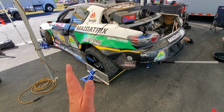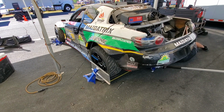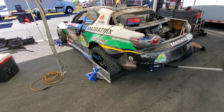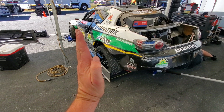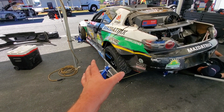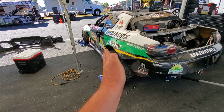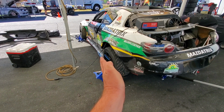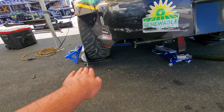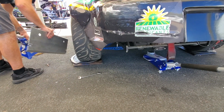Now, in regards to your camber, same thing. Factory suspension, different iterations of Mazda 5-link suspensions can move different ways under loading, but with the Wisefab, we're also looking for not any type of significant camber changes. Although in the RX8s, in most Mazdas, in most cars, as you go from droop to compression, you're generally gonna go from a camber out at droop to a camber in at compression. And it's really important that under your acceleration, under drift, under load, whether it be road racing or drifting or drag racing, you get a flat contact patch.